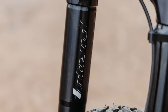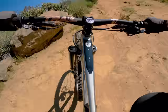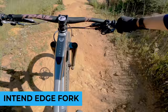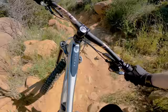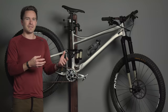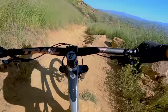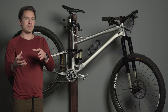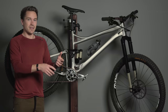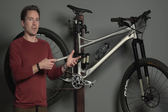The Intend suspension is not really readily available to purchase in the United States — we might try to change that in the future because after riding it I thought we really need to bring this stuff to the US. This fork, the Edge fork, has 170mm of travel and is an inverted fork with that motocross-style design. I've ridden inverted forks on mountain bikes before, but never one of this caliber. I have a feeling that in the next five years a lot of 150mm-or-more travel mountain bike forks are going to be inverted, because the engineering is getting the stiffness and weight in line with traditional forks, and the performance of that design is just way better — less unsprung weight and really deserving of its own full video.